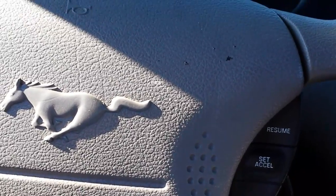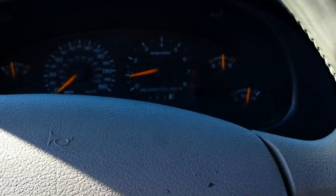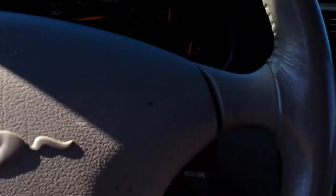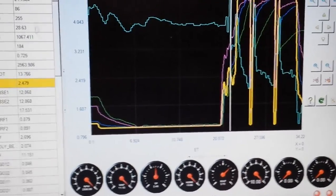So anyway, should be ready to put an adapter on there to get the turbo piped into that, reduced down to the turbo, which is only a 2-inch outlet. So I'm glad to be able to have it set up so we don't have to have that ridiculous 4-inch mass airflow sensor. Okay, I did a log.